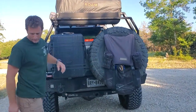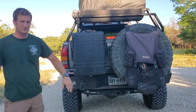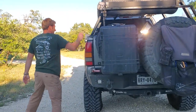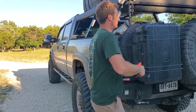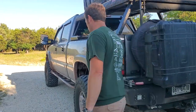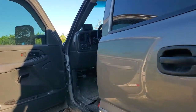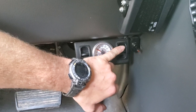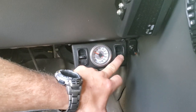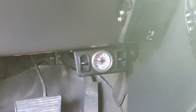I'll just drop it on the tailgate there — the driver's side is kind of low. So the driver's side needs to come up, passenger's side needs to come down, and then I usually put it on the bed side here. We're pretty level there but it could probably come up all together. If you follow me up to the front I'll show you the switches. This is a York 210 belt-driven air compressor with a two-and-a-half gallon tank that controls this thing, and a high auto switch that allows it to fill up and down a little bit faster. Here we have the driver's up and down and the passenger up and down. If you walk around out back you could probably see the truck move a little bit while I do that.